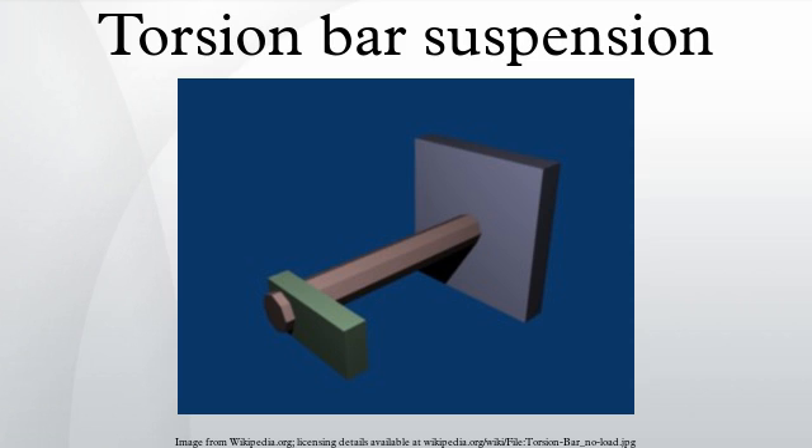Manufacturers change the torsion bar or key to adjust the ride height, usually to compensate for heavier or lighter engines. While the ride height may be adjusted by turning the adjuster bolts on the stock torsion key, rotating the stock key too far can bend the adjusting bolt and place the shock piston outside its standard travel. Over-rotating torsion bars can also cause the suspension to hit the bump stop prematurely, causing a harsh ride. Aftermarket forged metal torsion key kits use re-indexed adjuster keys to prevent over-rotation and shock brackets to keep the piston travel in the stock range.